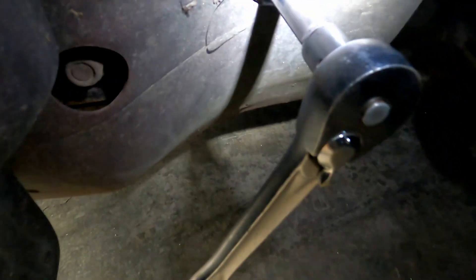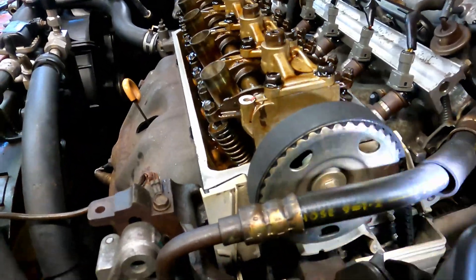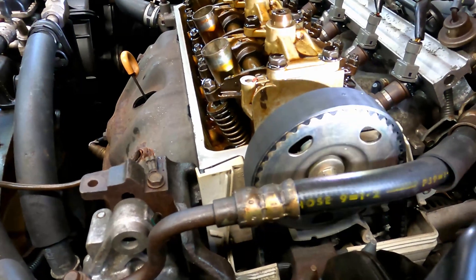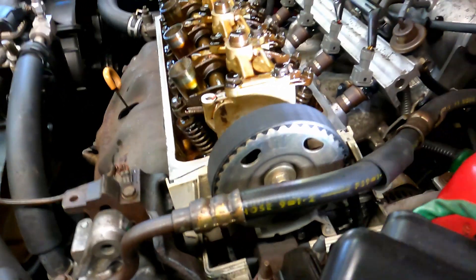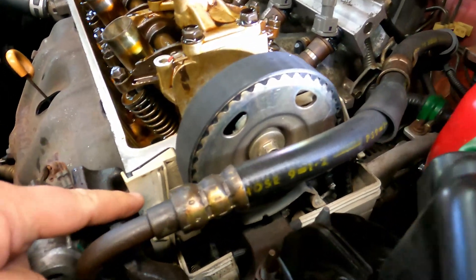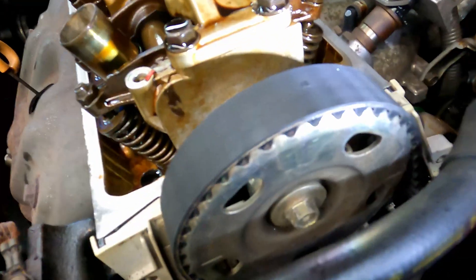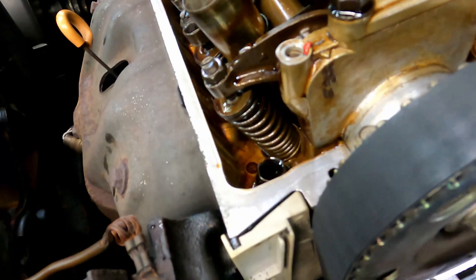I also put a mark right here so I can visually see when I'm getting close when I'm outside. It's not mandatory, I just did it to make sure everything was good. Then when you get in here, you're going to take your valve cover off — it's simple, about five bolts. Then take your upper timing cover off, and that's going to show you your upper cam gear. It says 'up' right here, and then there's two marks.